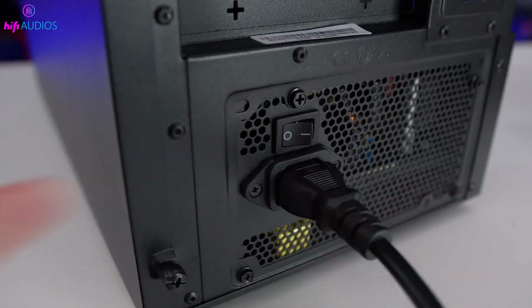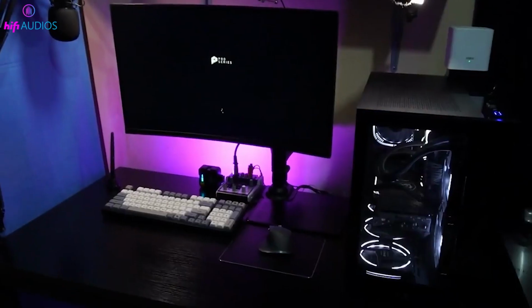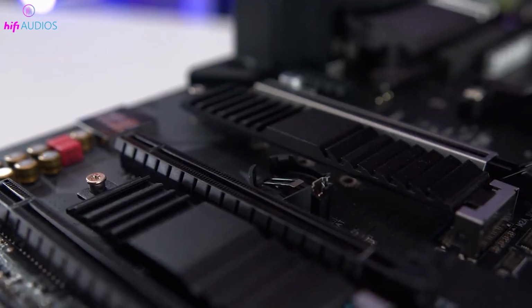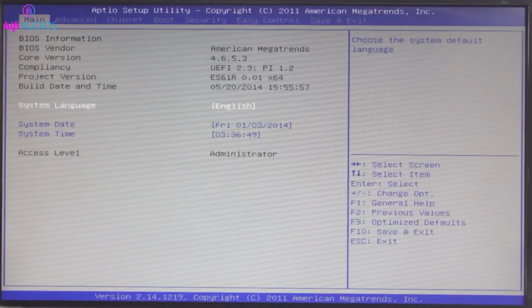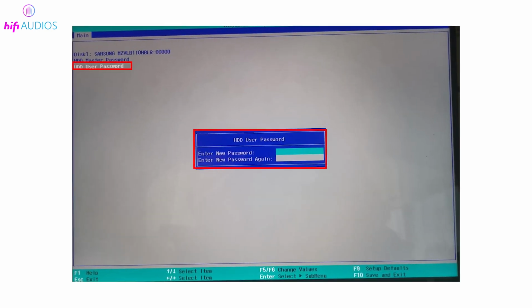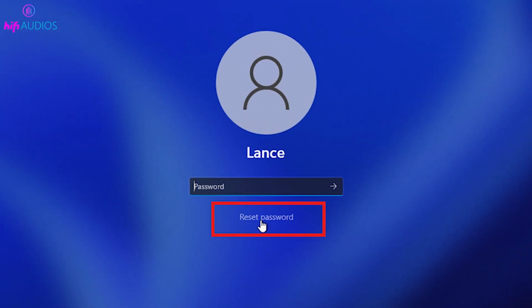One common way to reset your BIOS is by reseating the CMOS battery. This method works for both Dell desktops and laptops. Here's how you do it. Clearing the CMOS or NVRAM by reseating the CMOS battery resets the BIOS passwords. This includes the BIOS user password, admin password, and hard drive password. It does not include other passwords like Windows login or online accounts.